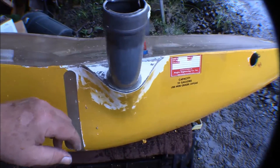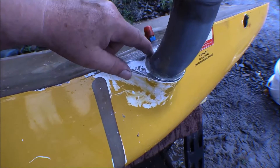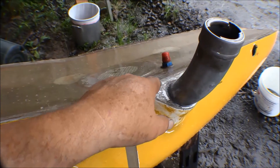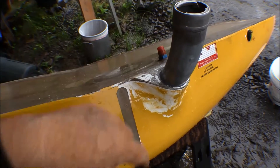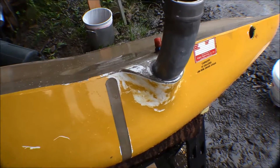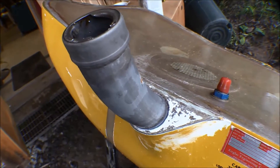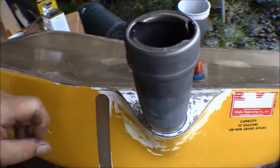I'll do a little more work and get it whittled down to see what else is there. I dug the Bondo out and there's a pretty good gap in there. I got the body putty off - it was a fillet around this neck and groove, which I used paint stripper to soften up the final bits. In the rest of the hole you can see the cutout - it's quite a bit bigger than the tube that goes in there. You'd want it bigger to get enough fiberglass resin in there to glue it in good.